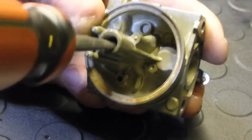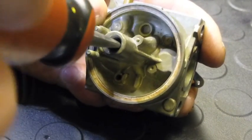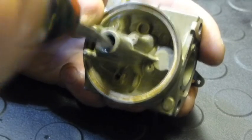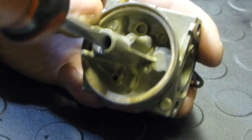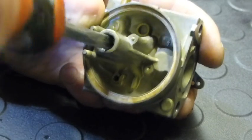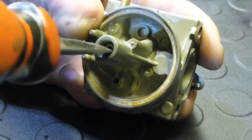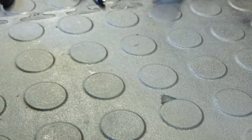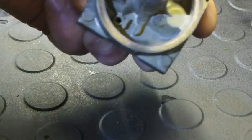The problem is that the jet is actually a different diameter thread to the one that holds the bowl on. It's smaller, obviously, but only just, and it doesn't want to slip down through the one that holds the bowl on. It gets caught in there as well. So we undo it so far, and you can probably hear it clicking around — it's off the end of its thread, but it doesn't want to drop out. No matter what you do, you can't get the thing out.